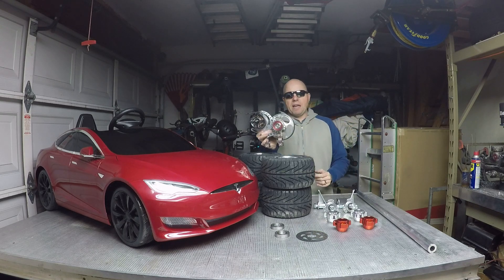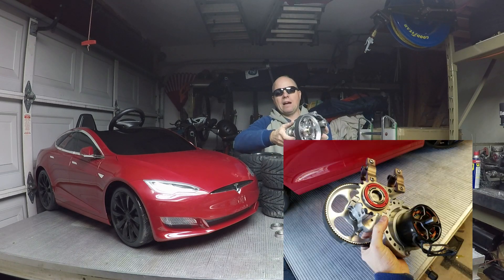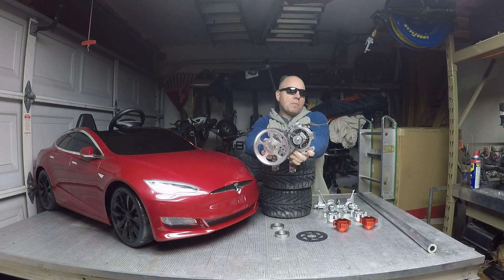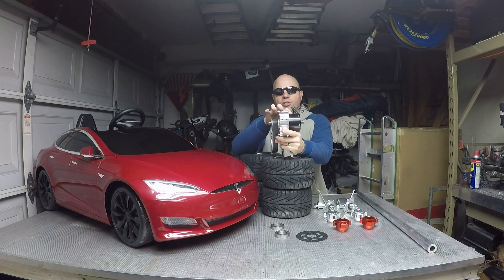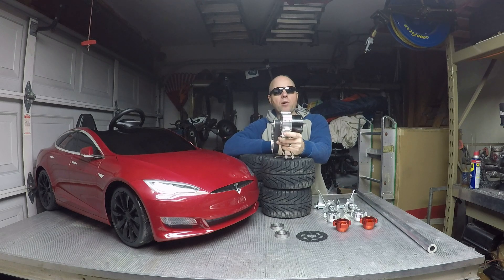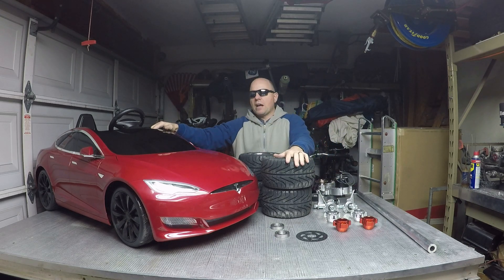This is one of the drive units that I manufacture for bicycles. It is a belt drive to a jack shaft, and then a chain from the jack shaft down to the axle. I also make a smaller, more compact version, and depending on the amount of room in the back I may go with that. This is an AstroFlight 3220 motor — rated by AstroFlight at four to six horsepower continuous, but the way I've spec'd it, it will put out around 14 to 16 horsepower peak for a few seconds for acceleration, and continuous output of seven or eight horsepower. I'll be building the car geared to go about 25 miles per hour top speed.